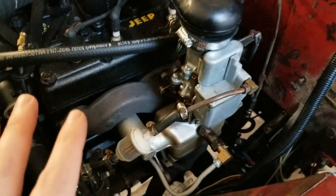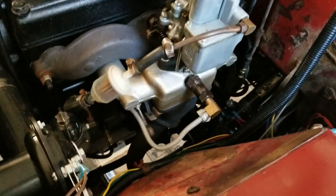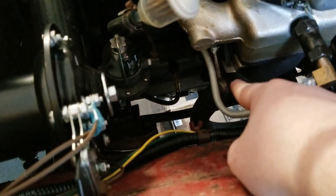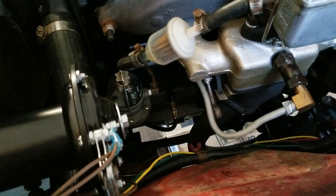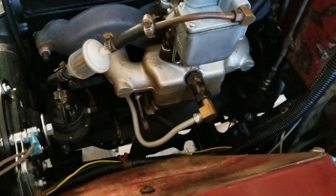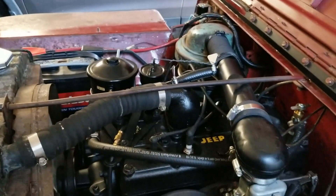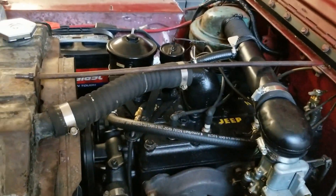It takes a really long time for it to warm up, but once it warms up it's okay. I might have an issue with this bi-metal spring here on the heat riser because I've been at it for 15 minutes, just let the thing run and tuning on it a little bit, and the heat riser is kind of hanging out there — it's not really fully closed. So I don't know if that's part of it, but let me stop yakking here and start it up.